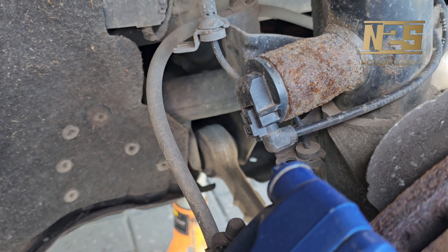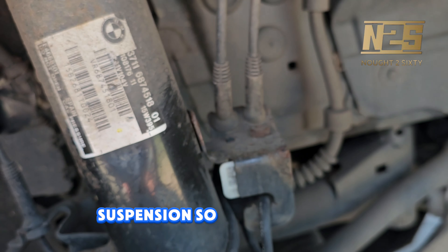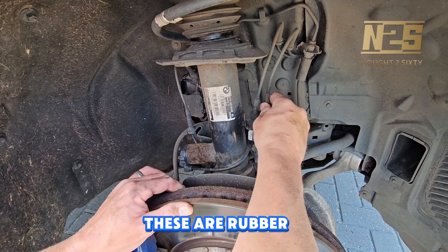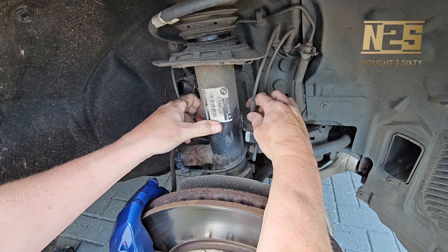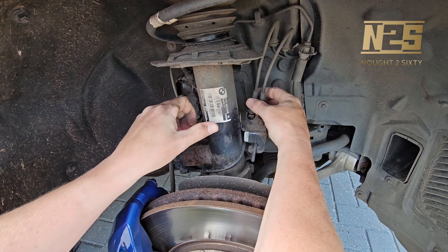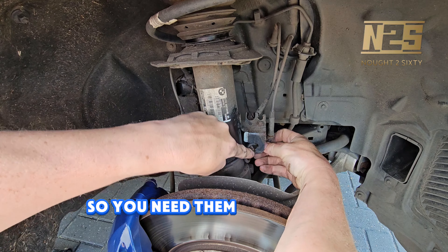You can see that there are several parts attached to the suspension, so we're going to remove those. These are rubber, so use two hands and push away from you to release them. They curl under at the bottom there as well, so take note of that — you need them completely loosened off the shock absorber.